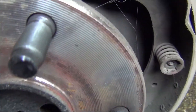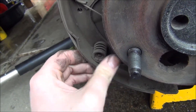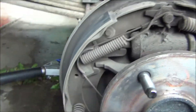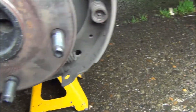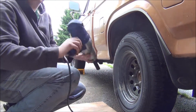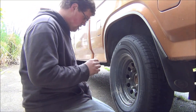I almost have a feeling this has had new axles put in, or at least new studs — they just look good. I need the push tool that pushes the spring in, and tools to break this stuff loose. We're down to the rivets, we need new shoes and new drums. This is an 11-inch brake, and this side uses a 13/16th socket — which is hammered, quite literally.